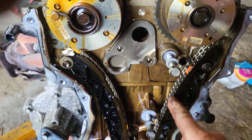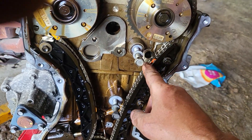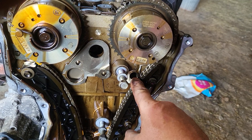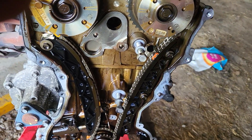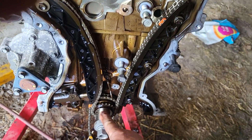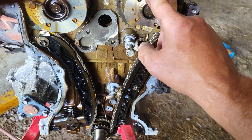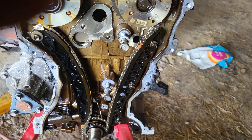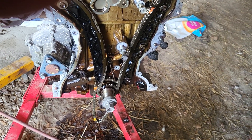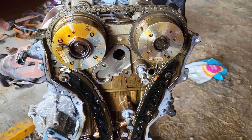These chain gears — you'd probably have to rotate it 80 times for those marks to land in the right spot. But for every two times your crankshaft rotates, your cams will rotate once. Anyway, that's how you get it in time. Now let me get the engine rolled over and I'll show you the damage.